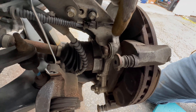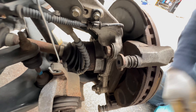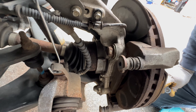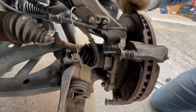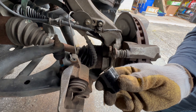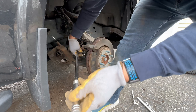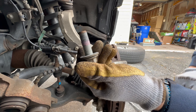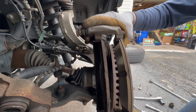Now you have two bolts for the brake caliper bracket — these are really tight. If you're using an impact you won't have any trouble getting those off, but they are torque spec'd to around 180-some odd foot pounds and it's a 21 millimeter socket. From the factory they do put Loctite on these. Once you get them broken free they come out fairly easy. The washer actually doesn't come off so you don't have to worry about losing it.